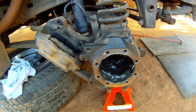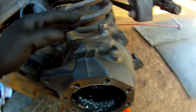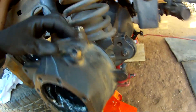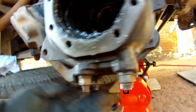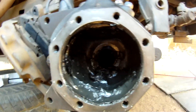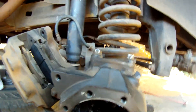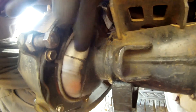The hub assembly is more or less identical. We've got the swivel housing around here — on the Toyota they call it a knuckle. This runs on the swivel ball equivalent and the seal at the back. It's got the top pin with two bolts and a bottom pin, and this one's got four bolts instead — it is part of the steering arm. But the grease is generally a lot thicker; you can see this hasn't drained out at all. I think it's just normal grease. The swivel housings are actually part of the axle — on a Land Rover they bolt on, so you can replace them as they wear.